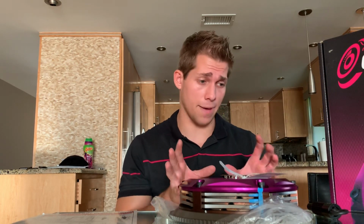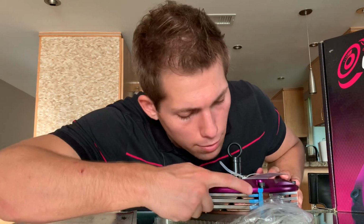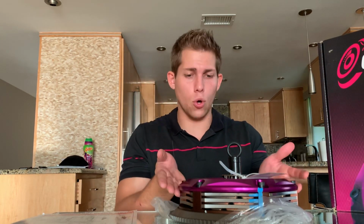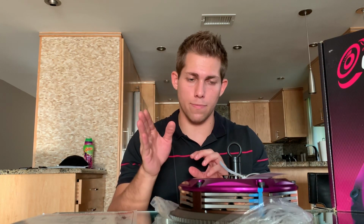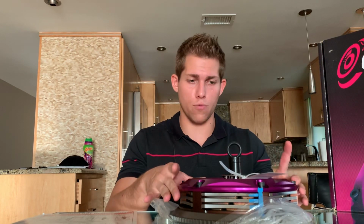So that's that. Now, the other thing that you get with this clutch kit is the alignment tool. The clutch alignment tool lines it up properly, so when you're installing the plates, everything goes in line. They also put paint marks around the clutch. The whole thing comes apart, so you put your flywheel on, crank the bolts down, and then you can put the divider plates, the clutch discs, and the cover plate on, and it all comes in layers. This is actually taken apart and not installed as it's shown right in front of you.